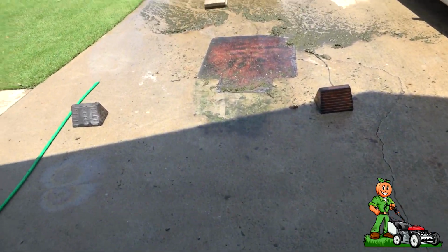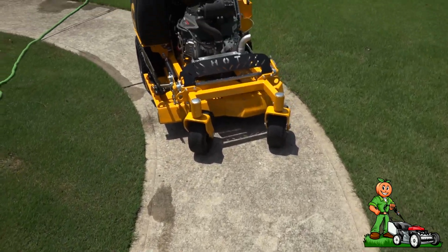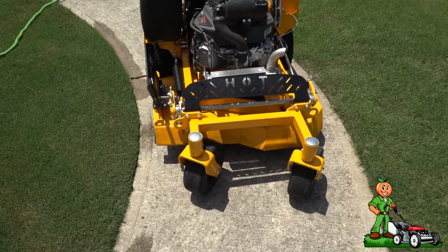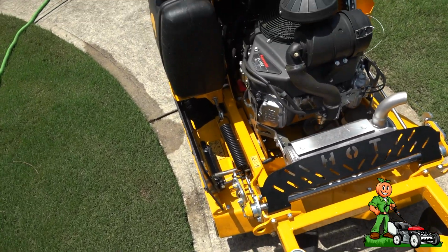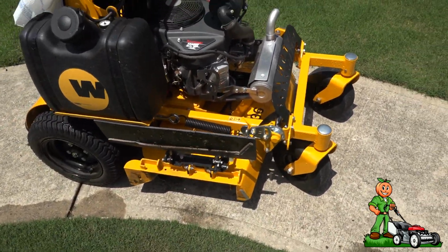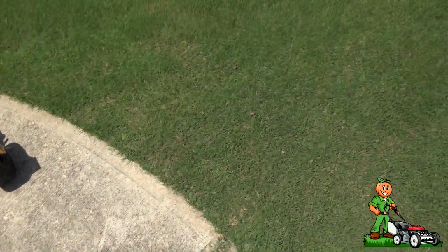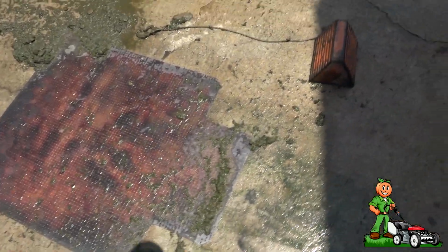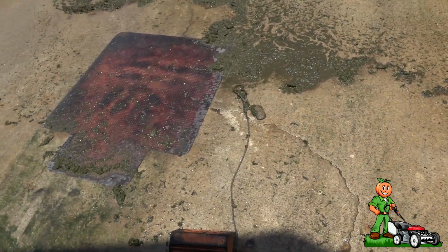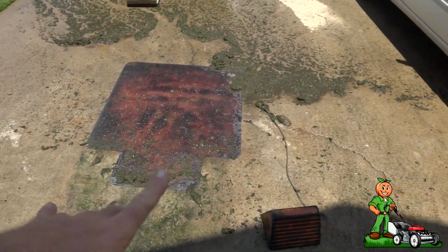Now, will I pressure wash the deck again? Yes. This is probably gonna be something I may do once a month, maybe once every 2 months. Certainly at the end of the season, I'll do that and make sure it's super dry under there. I don't want to let the grass sit on there. I do notice that when the Bermuda grass sits on there, I don't get any surface rust, and I will, obviously, with the high moisture content grasses. But anyway, so again, do you guys pressure wash the underside of your deck?